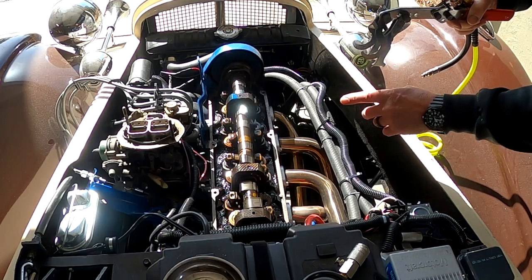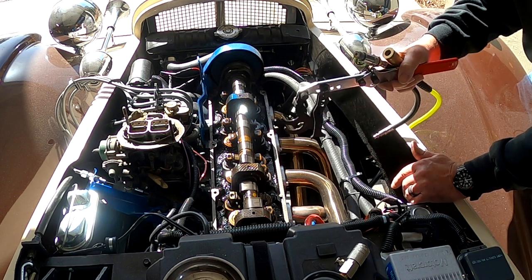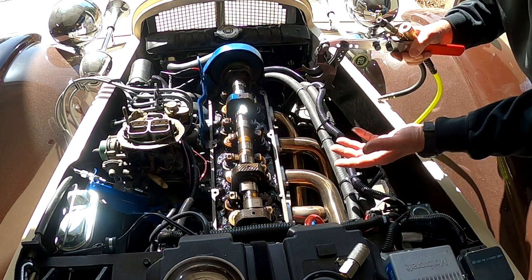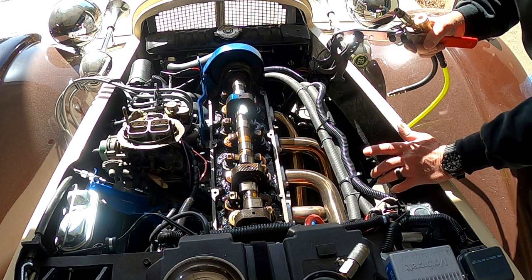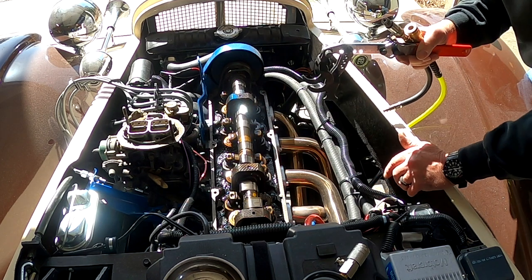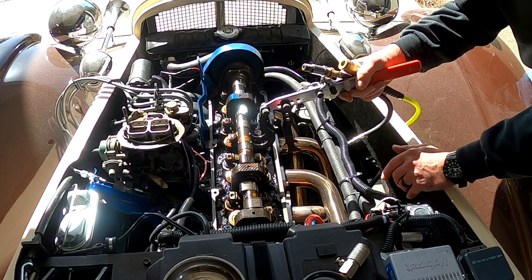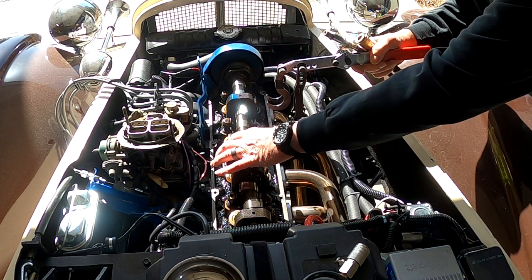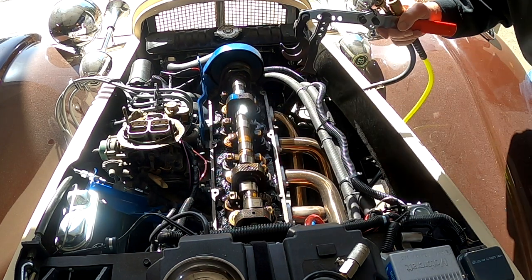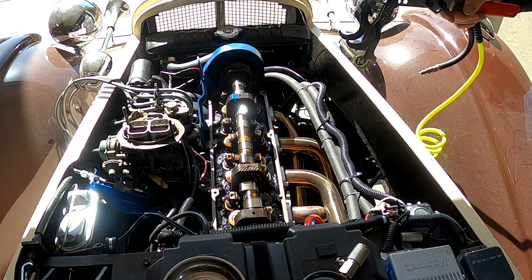This is a Ford 2.3 liter engine, and the neat thing about this engine, it's really slick. The rockers don't have any adjustment. They're hydraulic rockers. There's no adjustment to them, and they just simply come in and out. You don't have to take any screws or loosen any nuts or anything to take them out. So basically I'll just put this on, compress the spring, the rocker will just slide out, and then I'll compress the spring, get the keeper wedges off, and replace the seals.